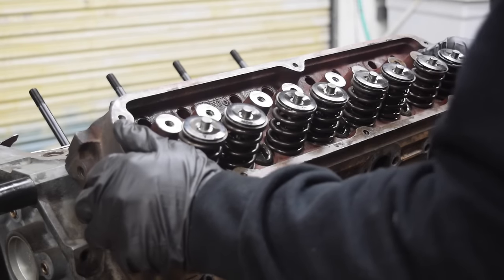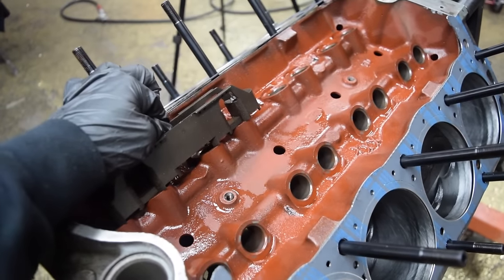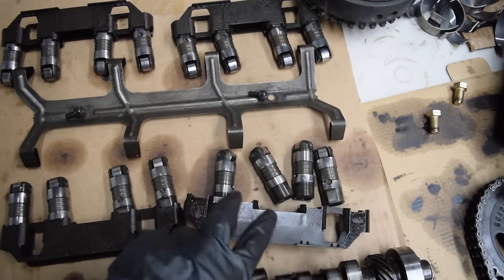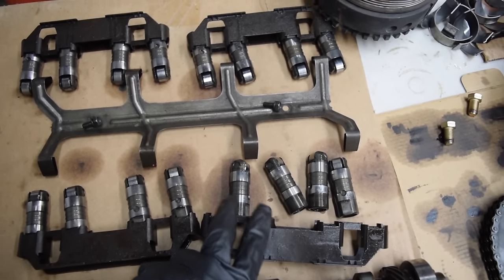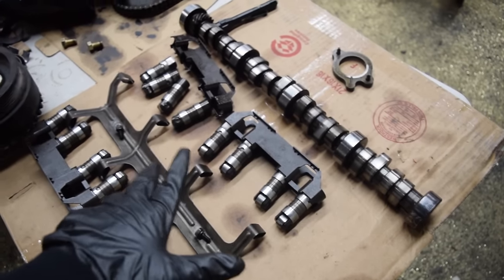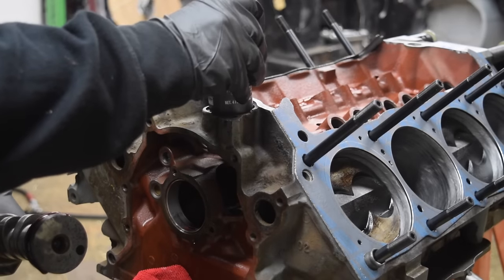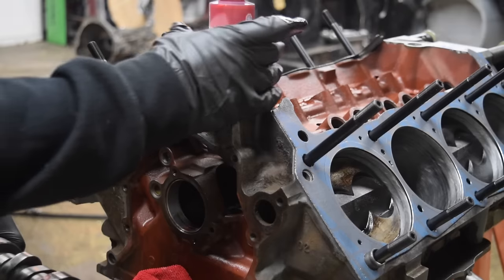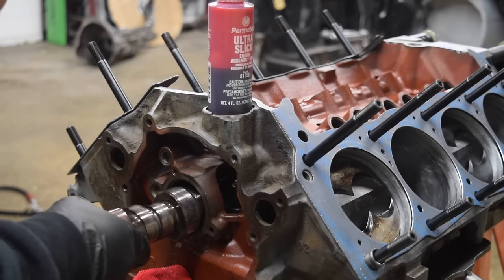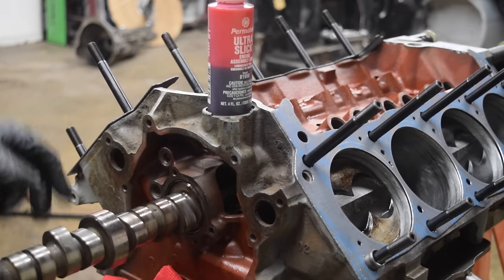Going to remove this head because I think I need to install all the lifters first — these little guards go right here and I think the cylinder head is going to get in the way if it's installed first. I know some assemblies don't have these; they just have a dog bone style so you can install those with the cylinder head on. Starting off with the cam install — just going to put some assembly lube where the bearing rides. It would have been easier to install the cam without the crankshaft installed, but I'm an idiot and I installed the crank and all the rods and the pistons first, and then I remembered.